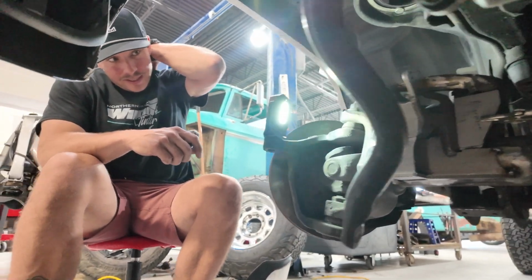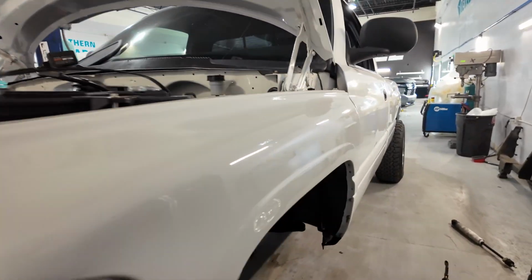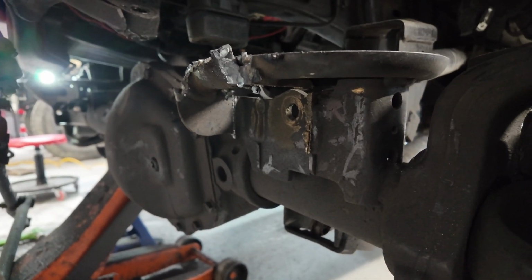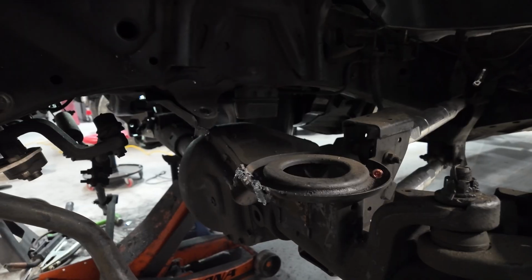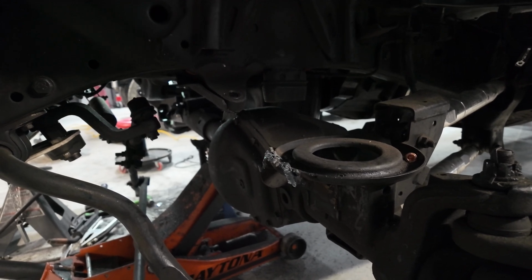Next will be the other side, getting the outside cleaned up. That side mount is a little bit different because it does not include the track bar. We did use a plasma to get most of it, and then a flap disc. Take your time. If not, what happens, Bryce? You have to weld the coil bucket where you blew a hole with the plasma.